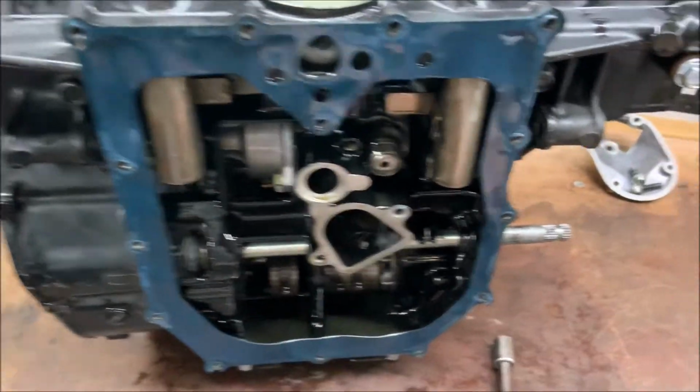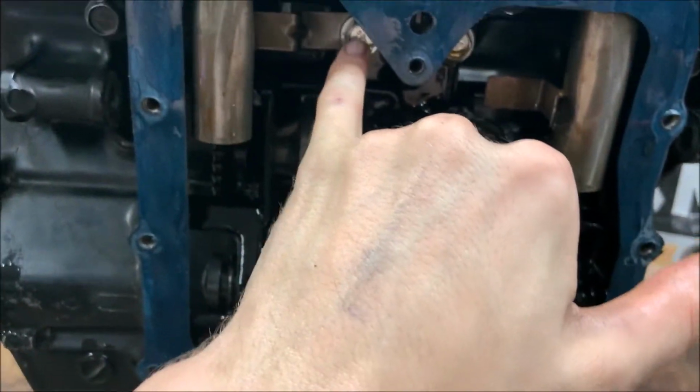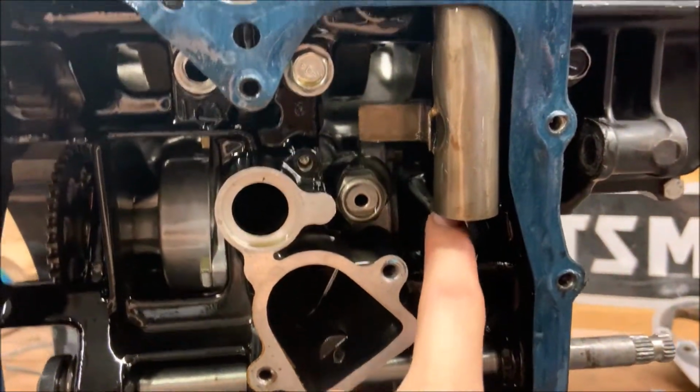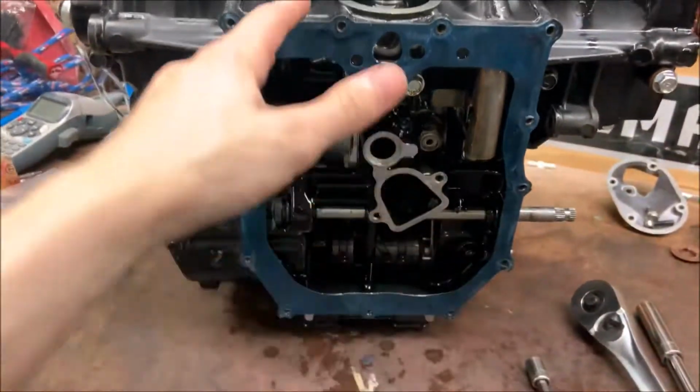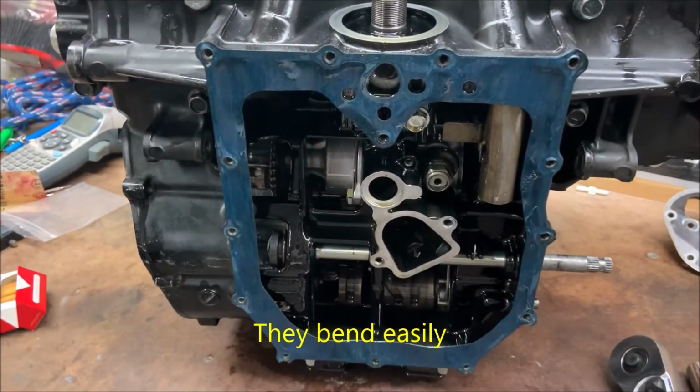It's got a little O-ring on it. And then we're going to be pulling off both of these pipes with what I believe is a 12mm underneath. So a 10mm holding this one on, and keep in mind, before you lay this down, you want to remove these pipes because they actually protrude out a little bit.